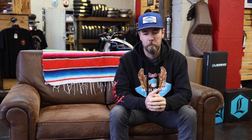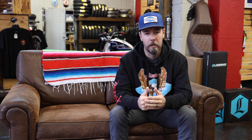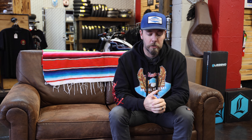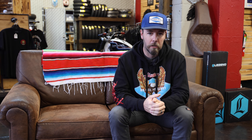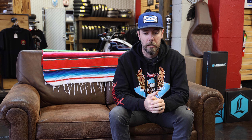I got the swing arm machined out underneath and got it to swing down — it would actually swing about three inches more than before, but I ended up making that two-inch block. I made a few minor adjustments to the bike, including changing one of the fairing mounts and making a new one, which ended up helping later on in the weekend.